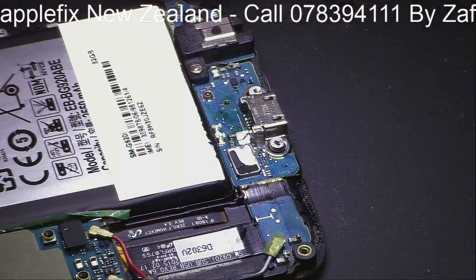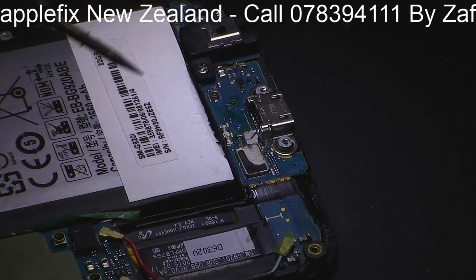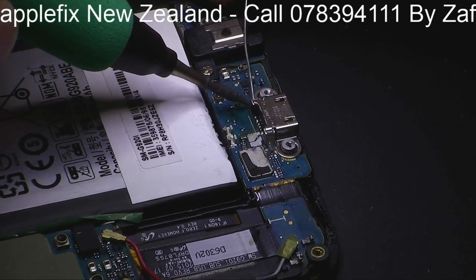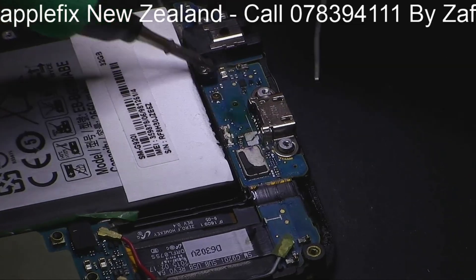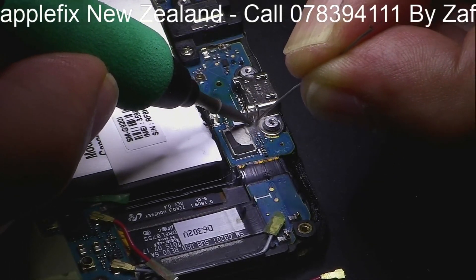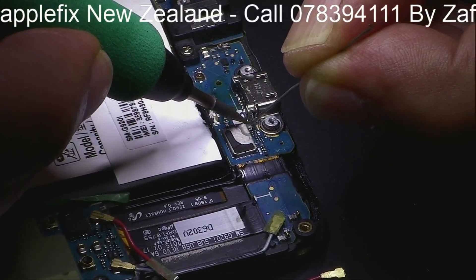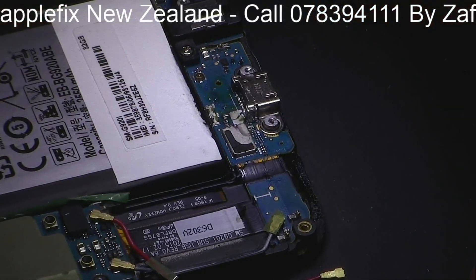Now I'm using a very, very low melt solder - maybe around 180 degrees - because if I use the same solder I used on the connectors, I might not be able to melt it easily on these ground pads due to the greater thermal mass. So anyway, this is all done.